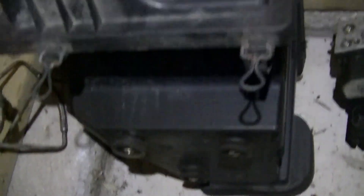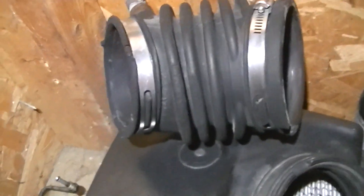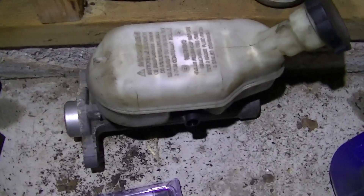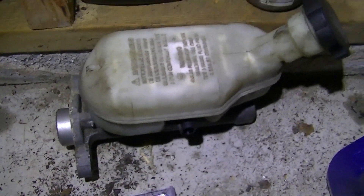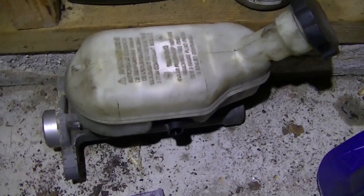You've got your airbox, air filter, bellows right there. You also have to take off all of your brake lines, including the two feeders from the master cylinder. It wouldn't hurt to take off the master cylinder too. Remember, this is a fuel return and supply line video, but here we are having to pull all this brake stuff off.